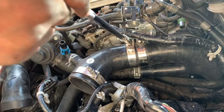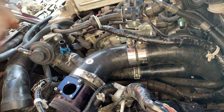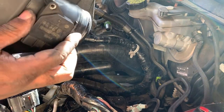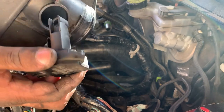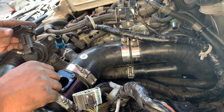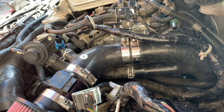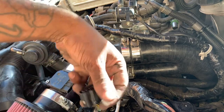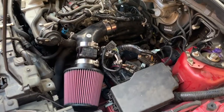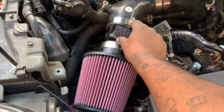Next I'm going to put the K&N filter on. Loosen it, take the screws out, and carefully look it out — you'll see some allen-headed screws. I'll show you those. Put it in just like you do your stock setup. Your plug is right here — just put it on like that. Alright, I have it on. This is what it looks like. Everything is tight — make sure you check that everything is tight. The MAF allen wrench screws are good.